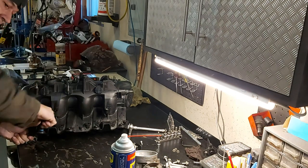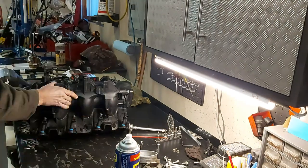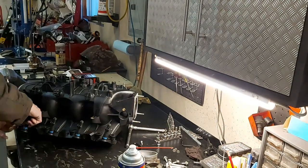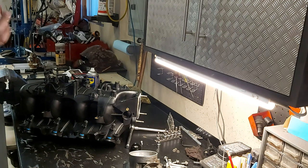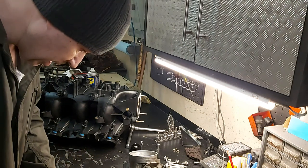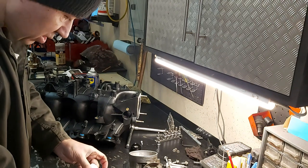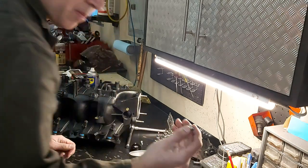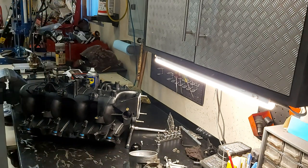That's in there. So we'll see. We'll see how everything seats once we put the fuel rail on there. Here's our Hillman half-inch nylon spacers that we need. And there are 1-inch long or 25 mil M6 by 1 pitch fasteners. So we need these longer ones because they're replacing the shorter ones with the shorter injectors. So we'll see how this goes here in a second.